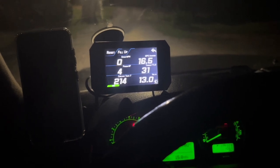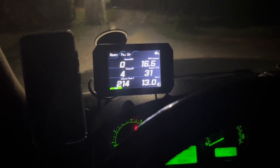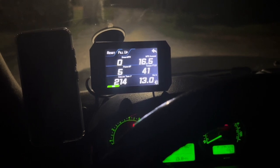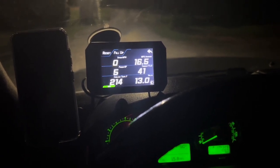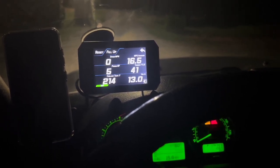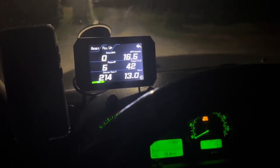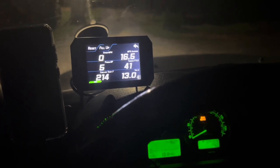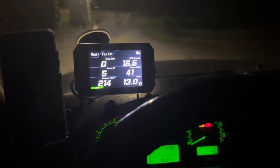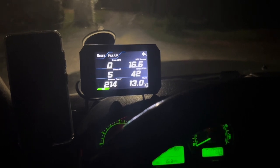So when I first bought it, I removed the thermostat, and when I did, I sort of fixed this issue, and the problem went away for a while, and I was able to drive it for, I don't know, maybe 11,000 miles. And then I thought, okay, well, let me install the thermostat. I installed the thermostat, but I did not use a special tool that puts vacuum on the system, so that when you refill it with radiator fluid or water, like in my case, there would be no air pockets.